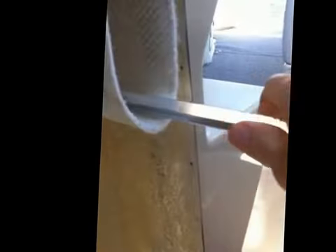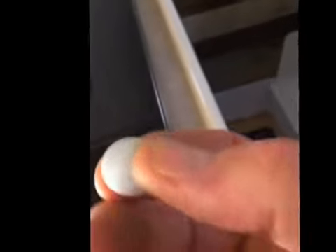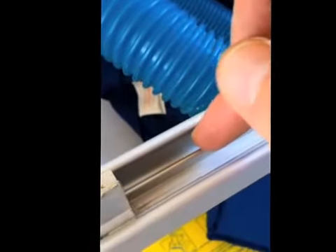The way to get that material folded back on itself — because it sticks to itself almost like it's half of Velcro — I just used a bit of the trim and slid that inside, then slowly worked the end up upon itself, pulling down on the trim at the same time. With that nice and deep, you've then got the track. This is the track piece upon which the bottom foot of the door sits. Upside down, you can see the ball runners in there, and guide runners on each end of the track itself, held in with Phillips head screws.